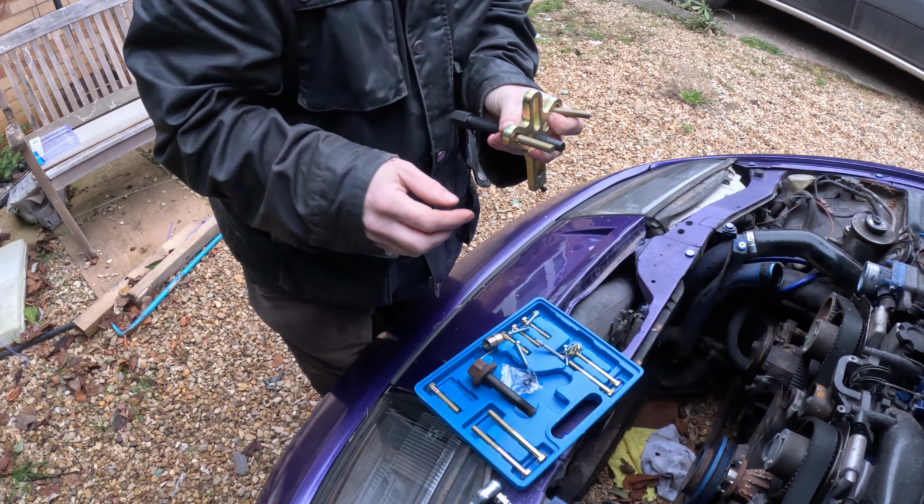Yep, that's that. So theoretically, if we had to move that, ow. Guess not. So, to move that up, because normally that doesn't come off, there's an adjuster bolt on that down the bottom, a little slider. But there's also a pivot bolt, which I think is that one at the top of the alternator, which I've tried a few sockets and it appears to be a 17. I think it's in the right place to be for pivoting, so let's see what happens.